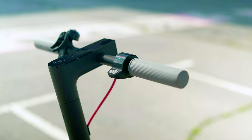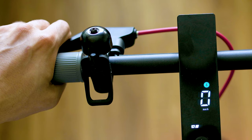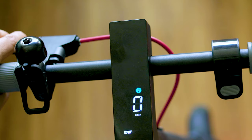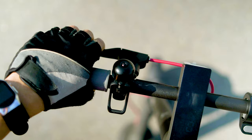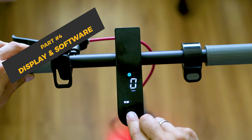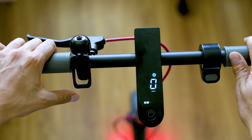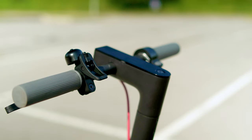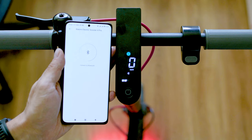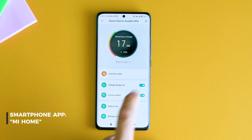Going up the stem — this area is almost identical to the Xiaomi Scooter 3. Handles are comfortable, the brake triggers are well responsive, there still is a bell integrating the lock mechanism and a nice display. Given that most of these scooters are used in open areas, often in hot and sunny places, Xiaomi should figure out a way to improve visibility — a basic monochrome LCD would be a much better solution in my opinion. Although the display here is AMOLED, you can really enjoy the colors at dawn, at night or when the weather is cloudy. Besides showing speed grades and letting you switch between gears by double pressing the power button, it also hosts a Bluetooth module for connecting to a smartphone app — ways to lock the scooter, update the firmware, and enable or disable the cruise control. It's back, fully working, and I hope it wouldn't disappear after the next firmware update.